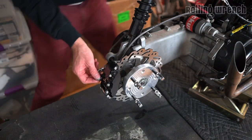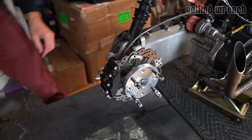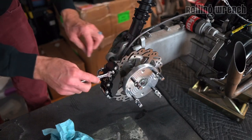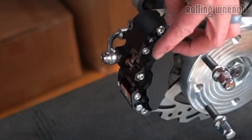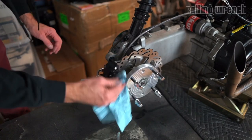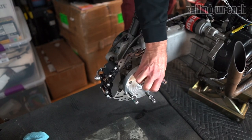Final steps: squeeze the lever to make sure there are no leaks around the banjo fitting. Make sure your dummy bleeder plug is tight, same with your bleeder valve — then put the dust cover back on. Clean everything off really well since this stuff eats paint and finishes. Turn your wheel, push the brake, turn it — we're good. If you enjoyed this content and learned something, hit the subscribe button, leave a comment, and tap the bell for notifications on new videos.